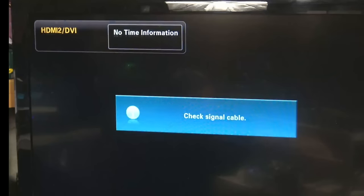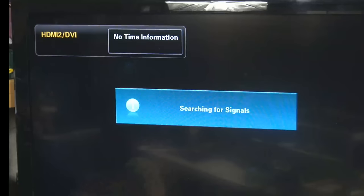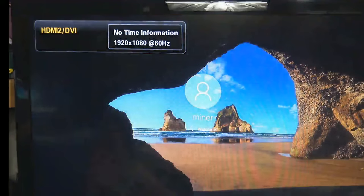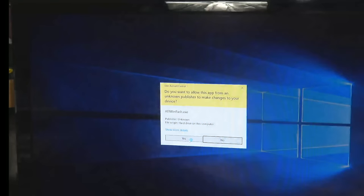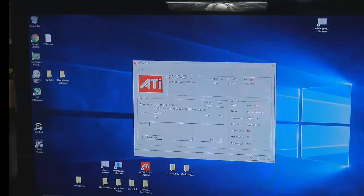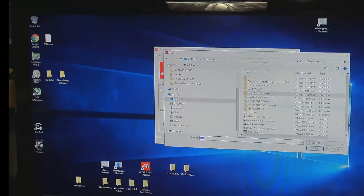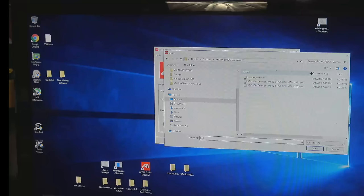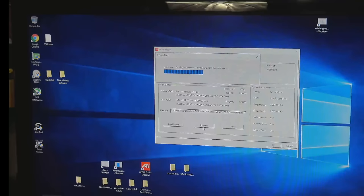So what we're going to do on this particular one is go ahead and go through that operation. I'm going to take it down to a lower setting, and we're going to sit there and watch it for a second. We're going to get this loaded up here. We're going to run this here. And since I already had one pre-programmed, we're going to point to that software. It's on the desktop here. I got it under the crimson here. This is the BIOS that I was running that looked like it was stable, but then it did a freeze. So then we're going to take it down to 2125, and then we'll edit 2150 and 2175. We're going to program this one and take it down. It's okay, I mean, hey, if it fails, it fails sometimes.